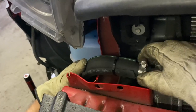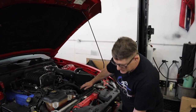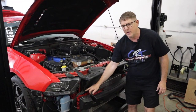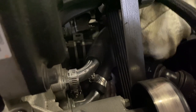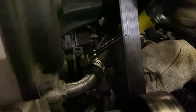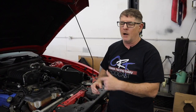So we got the hoses connected. We've got our feed from the tank — this now goes to the heat exchanger — and then we've got our return that goes back to the tank. In a race car application, race only, you could do away with the heat exchanger and literally have the tank with the ice water going right to the intercooler and right back to the tank. But being this is a street-driven car and it's also bracket-raced, we're going to keep this heat exchanger. It also has electric fans, so we'll get a little bit of extra cooling.